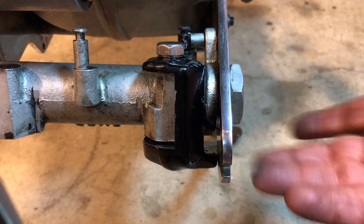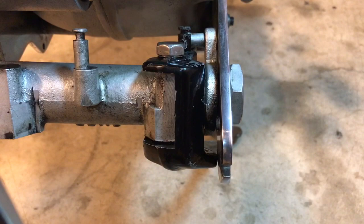And as we look at the side profile here, you'll see there's no clearance. In fact, it's pushing up against the bracket. So there's some flexibility in the unit itself, but that's not what we want, because when we lift the bike, we want the whole stand to just swing all the way forward into a vertical position without having to like drag it forward with a foot or something like that. That's not the point. So I'm going to look at the profiles now and then maybe do a little bit of filing down.